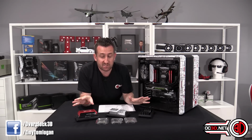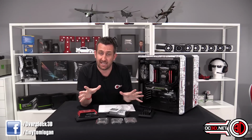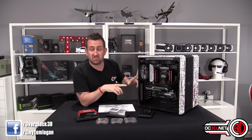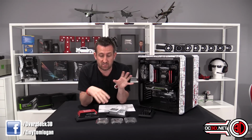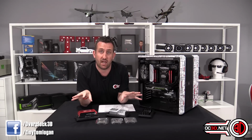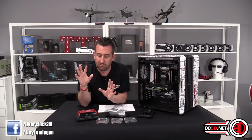Now, I do need to be very, very clear. I'm experiencing this stuff because I've had the pleasure of working with it early. When you get your motherboard, if you buy one of these new boards, or even update your BIOS on the old ones to work with Broadwell-E, the QVL and all the little issues that I'm finding now should all be fixed. Every time I've found a problem, I've been relaying the kit numbers back, and it's all been getting updated.